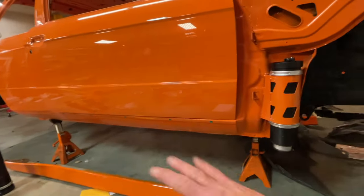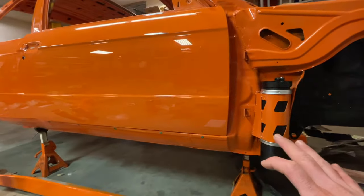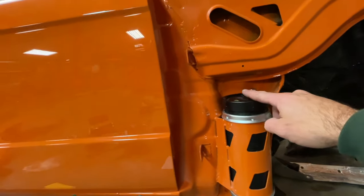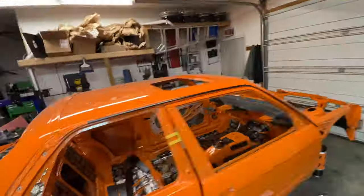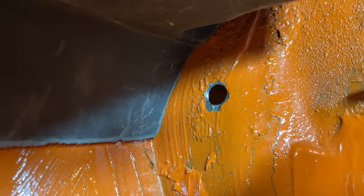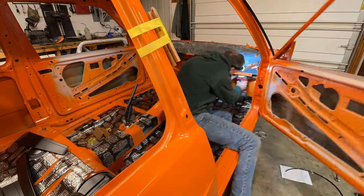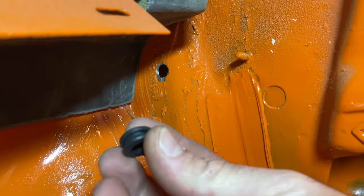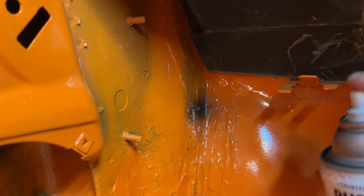We have a lot of work to do from the control side, but from the installation side right now — which is what I'm mainly concerned about on this chassis — I need to start routing the airlines and they all need to go to the back of the car. That's where the hole is going to reside and I need to install the grommet here. Always want to grommet these things so we don't have any exposed metal in there. We'll paint it as well and install the grommet right through the hose.